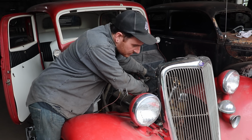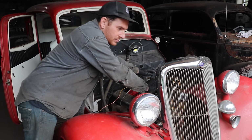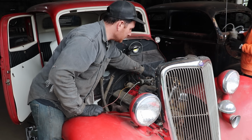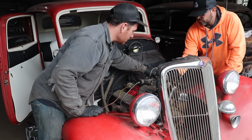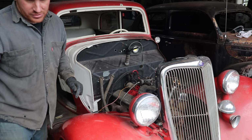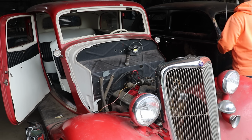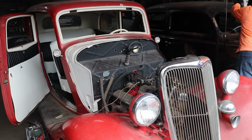Yeah, it definitely pulled. Did it? Well, no, it looked like it did. Maybe it didn't. Nah, it's not pulling. Fuel pump's junk, or diaphragm needs... Yeah, but diaphragm might be... Now we got it running, crap, and the fuel pump needs rebuilt, but everything else is working.